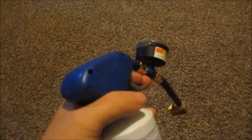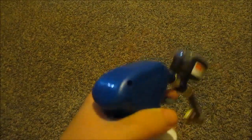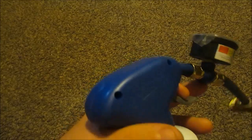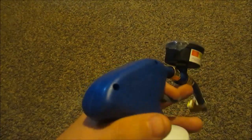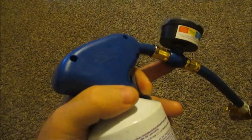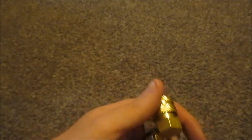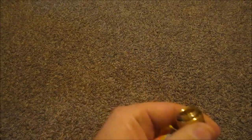When that's on, you start up your compressor. Sometimes the compressor will kick on when you turn on your system if it has enough pressure, but if it doesn't, you have to jump it out and make it manually run like I did — mine was so low it wouldn't come on its own. Then you just push this valve in and hold it — as long as you hold that valve in, it starts filling. Then you turn off your compressor, turn off your system, pull the hose back and pop it off.